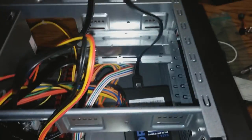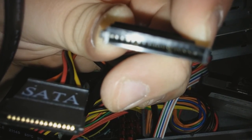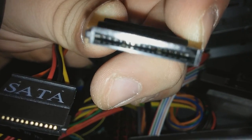Pull this guy out. Alright. Battery notifications. It's getting kind of low. That's fine. And he's got to match the little notch. Come on. Come on. Okay, you'll see it when you look. There's a little notch inside the area. You can kind of see it like that. Match it up to the notch that's on the SSD, which is super easy. It's literally like Legos. Then, gonna jam it down in there. Make sure I still have access to this.